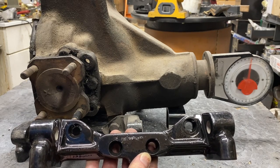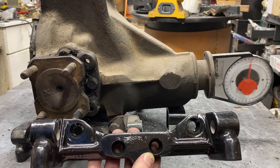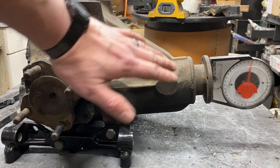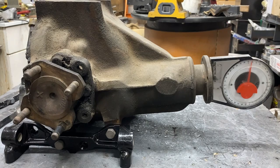So we now have the five degrees at the pinion, but the lower control arm will be moving perpendicular to the road. Here we have it with the XKE brackets installed. You can now see that the pinion is tilting up and it looks like we're getting just a hair over five degrees — right at six degrees. That is a simple solution to get your pinion angle much closer to your transmission angle and still have everything mount up correctly and have the lower control arms move perpendicular to the road.